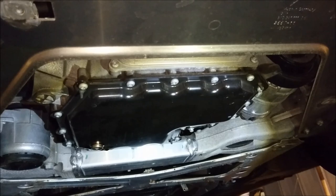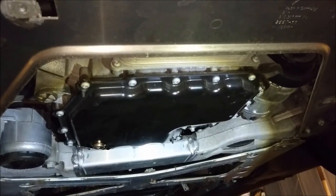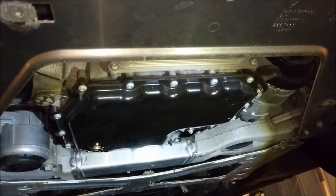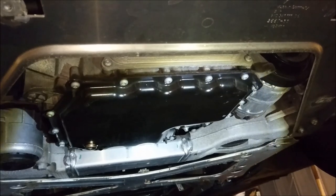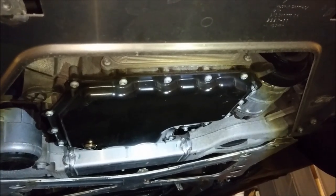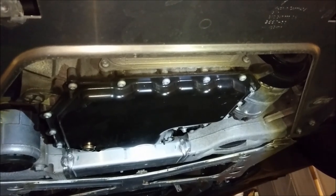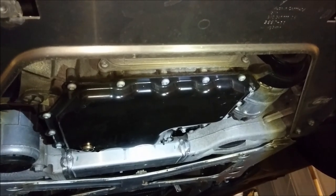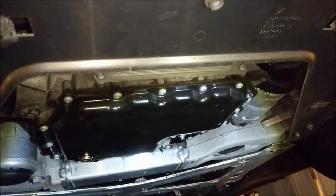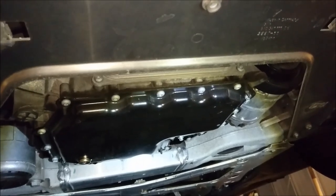Other than that, it was pretty straightforward. The V6 3.6 liter takes about 8.9 quarts of oil with the oil filter — that's generally what you want to fill up the car with. I use Liqui Moly made-in-Germany oil, just because I feel like it's the best oil out there. I use 5W40 weight since I'm in California, but generally speaking you can use Mobil 1 0W40 or any European formula oil.